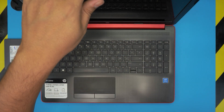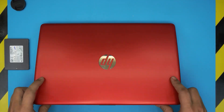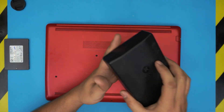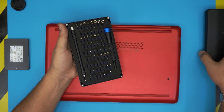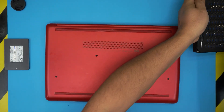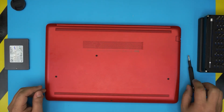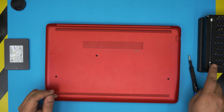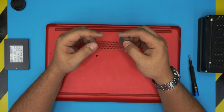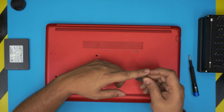Let's get started. First, power off the laptop and back up your files. You're going to need a few tools. Tool number one is a screwdriver set — I recommend an iFixit screwdriver set, and we'll be using a Phillips number one. If you get the pro set it includes tweezers and opening tools. For opening the case I'll be using a guitar pick, which is really suitable for opening covers — the soft edges won't damage anything.